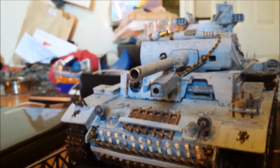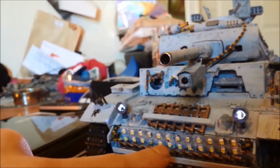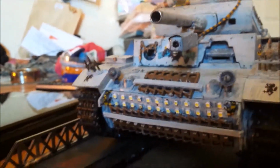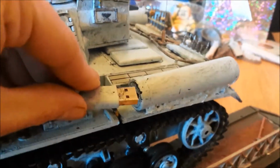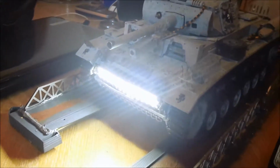So what I did is, I added 2 strips of LED lights here. Here's one strip, and here's another strip. They're super bright, dense lights. In the daytime filming on this camera it's great, but in the evening in low light, if you're driving around in dark places, you can't see much. So these LED strips that I've put on are 12 volts, and I'm powering them from this battery bank at the back here, and I'm using just the power lead on the LED lights as the switch for them. So I'll show you. You can see they're really super bright lights, and they do a good job.